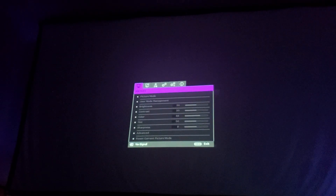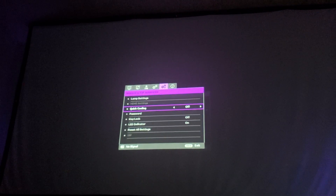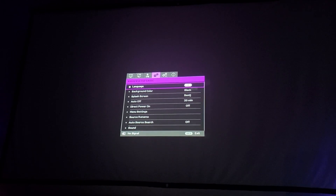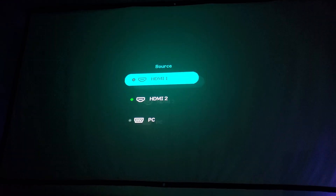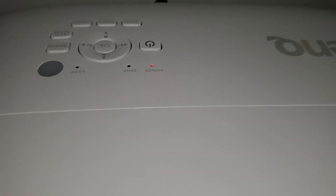We're going to turn off auto source search again. Let's see — there's quick cooling. I'll leave it on; maybe I should leave it off. Let me see if I can do something here to save this thing. As soon as I go back to the source and select the HDMI input, it's going to shut off automatically — because it thinks it's overheating and won't run the color wheel. And there — it turned off again. Same thing. Not a lamp issue, not a temperature issue — just a faulty power supply.